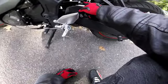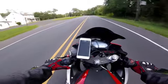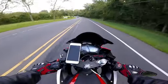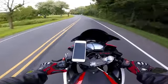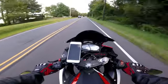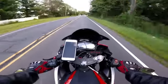When you're taking turns or corners, you need to take them a little bit slower and a little bit wider than you normally would, because you have a little bit more weight, and it kind of transfers a little strangely. If you've ever taken an MSF course, you know how the physics work out, but the difference in weight and tire pressure and suspension settings on your bike can change the way you lean in corners and how you travel and the way your bike feels when you're riding.